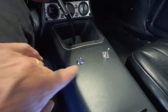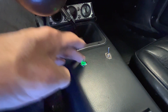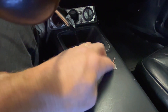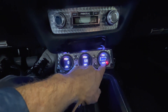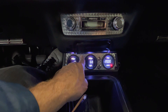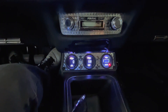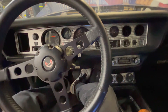Even though I only drove a few miles, I cut open the filter — it looks great, no metal, oil looks good. I added a few switches here. This is an override switch for one of the two fans. In one position it'll run on the battery; the sensor would also run it if the car is hot. Another position is just off so the fan won't run — useful going down the highway. I've got oil pressure, water temperature, and air-fuel ratio gauges. This is the override for the second fan. I can bypass the heater and bump the idle for the AC — also handy in winter. I can dim or brighten the display, or turn these switches off to go back to 1977 with no digital stuff.